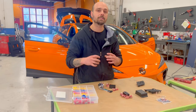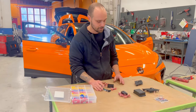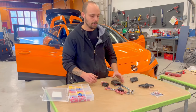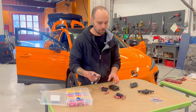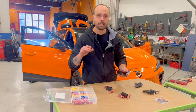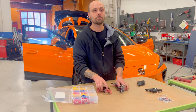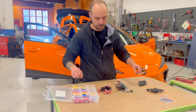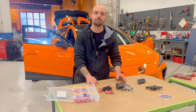Now, if you turn on the sound system, you can listen from the speakers, but it's not through the amplifier. So now this is placed under the glove box of the car. I will show you now, we will demonstrate which cables we need to cut, and we will put our adapter. And after we put our adapter, we need to connect the lines that are going back to the amplifier and to put these two crossovers that will send the lines for the tweeters up on the dashboard, and the rest is going inside the doors. So I will show you all this now.